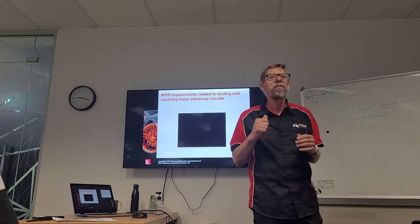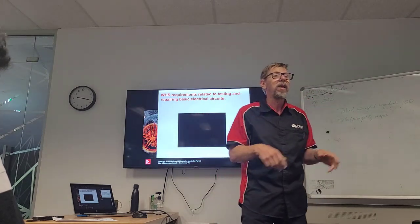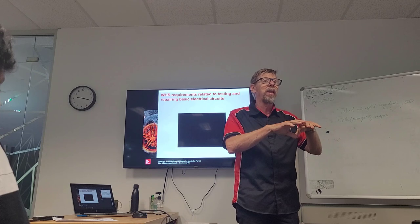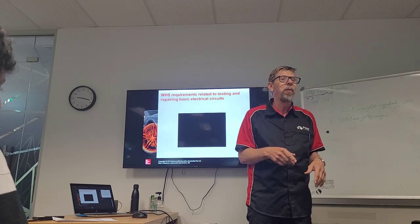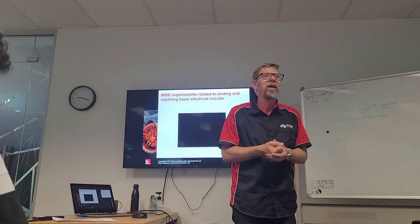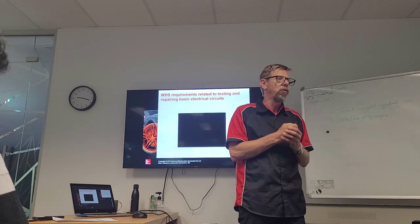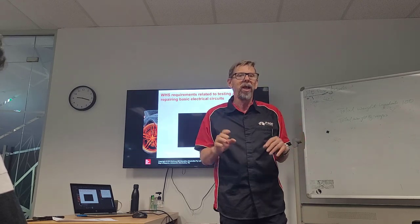And we need to be aware of what we do if we do get an electric shock. Someone in our workshop has an electric shock. As Jeff Smith said, if some high voltage is on you, you're not going to go as a rescuer and touch that body until you get a broomstick or something that's non-conductive to remove that source of danger, okay? So that's important. So just keep all that in mind.